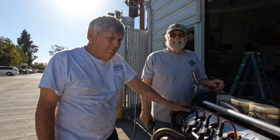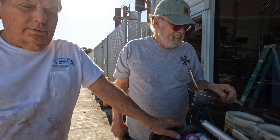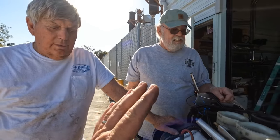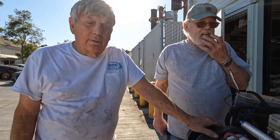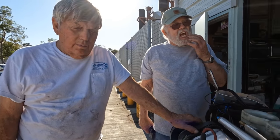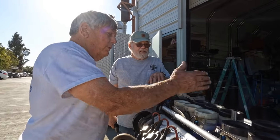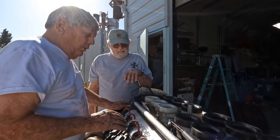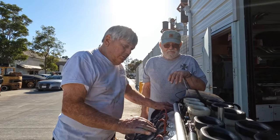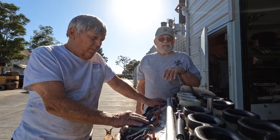But essentially, are you kind of saying that it's almost like providing boost to a couple cylinders where it's not provided, because you're forced air, ram air induction? Exactly. But a couple of the cylinders may not be getting any forced air. Some are getting atmospheric and some are getting forced air. You could baffle that thing inside somewhat too if you wanted to. Put a baffle right here, I guess. Yeah. But that would be hard to figure out. You can't test it even on the dyno because you don't have the airflow. Right. That would take a little bit of work.